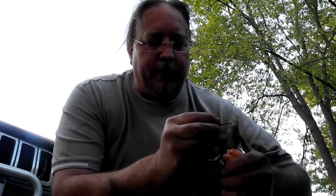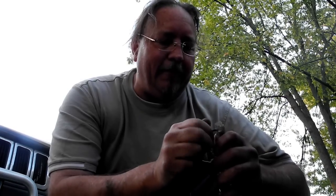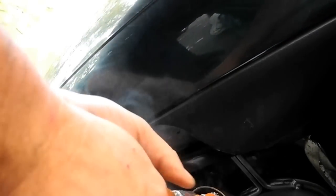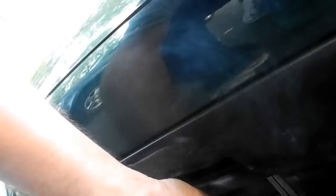Light the cigarette. You can see I'm already getting smoke. Put the cigarette holder in there so it doesn't end up somewhere up in my exhaust. And then here we go into the exhaust — this just fits. That's why it's taped and foamed. I'll shove it in there. Now I'm going to tape it on the rest of the way so that it holds as much smoke in there as I can.